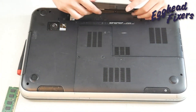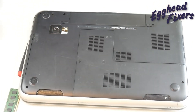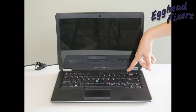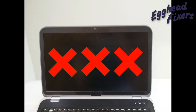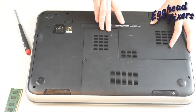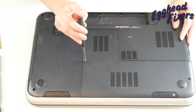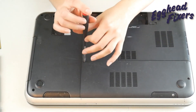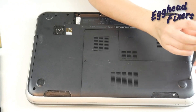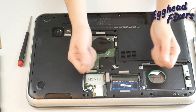The reason I'm doing this is: if with one stick of RAM the computer turns on with just the one installed, then I know that the stick of RAM outside of the computer is giving me trouble — it's preventing my computer from displaying. So if I turn it on and it works, great. If it doesn't work, then I'm going to repeat the process, only changing out for the other stick of RAM to see if that's the one causing the issue. As a side note, sometimes your RAM can just come loose, so it's always worth trying to uninstall both sticks and make sure they're installed properly.